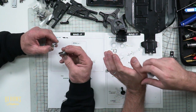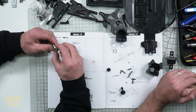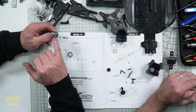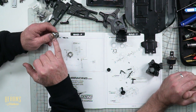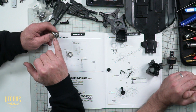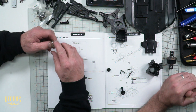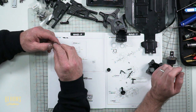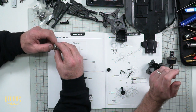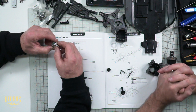The only way you can distort that shim, because it's on a flat surface, is either heat or lack of lubrication, and that's just poor maintenance. I've never had a drama with them. Every race meet, I'll take the boxes apart and check over them, because this is electric, whereas nitro guys will run their cars for hours at times.